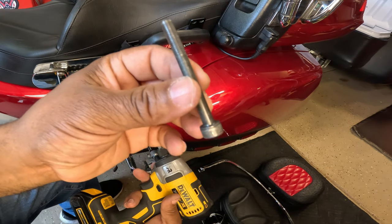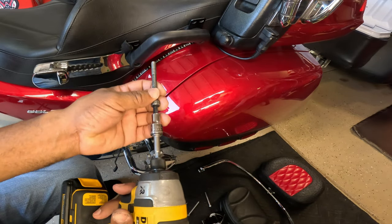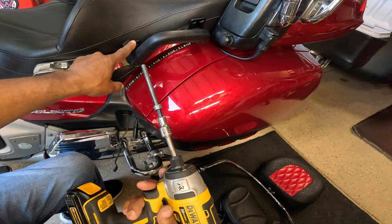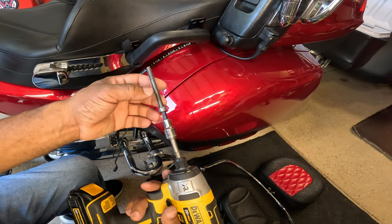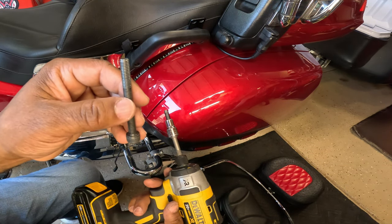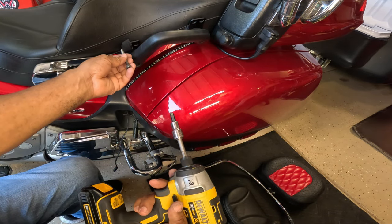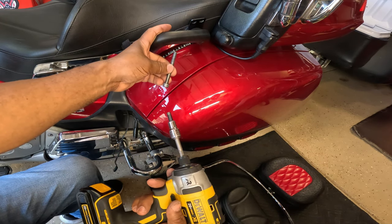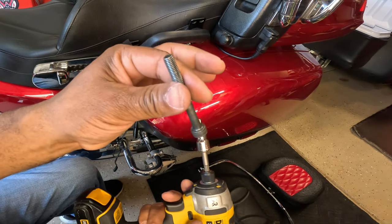and I took the original seat bolt and I threaded it all the way through the frame of the original threads, because it appears that when Honda manufactured the bike, they didn't run bolts all the way through the threads. They just ran it just enough to get a bite, which works fine if you're running just the grab rails. So I removed the seat, I took the original bolt,